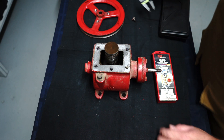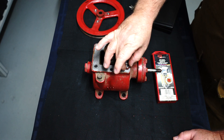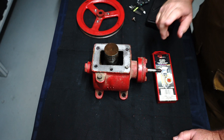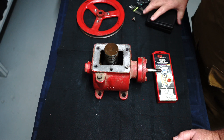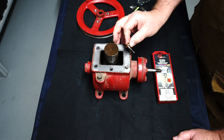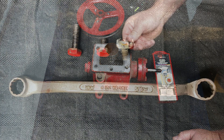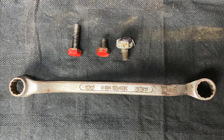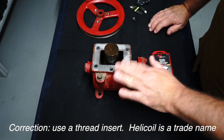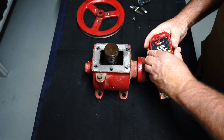What I'll do is weld this nut on and that should pull the bolt out. I'm not worried about the gasket — I'll remake a new one. Second of all, I'm going to helicoil these and get rid of these Whitworth bolts. I honestly hate them. Luckily I had an old Whitworth spanner to get these bolts off. I'm going to drill them out and helicoil them, and I've got this old recoil set here which I've probably had for 25 years.